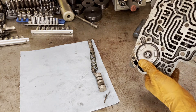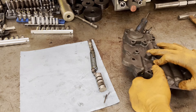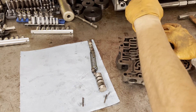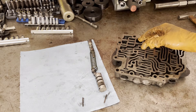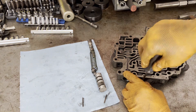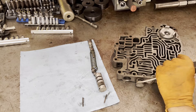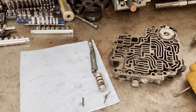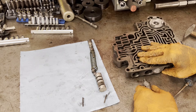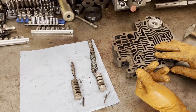This is your 2-3 accumulator, which I take out on the press. Just pry it out from the rear on the valve until you can expose the little slot for the retainer pin, and then pry it out from there. If it's real stubborn, you can tap on it lightly with a screwdriver. Most of the time you won't have to do that — just grab and twist and it should come out.